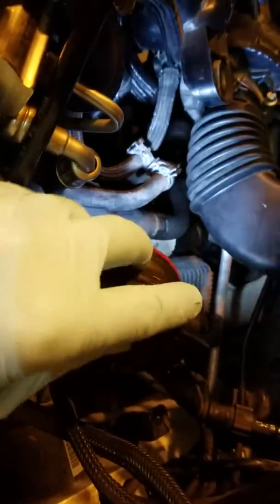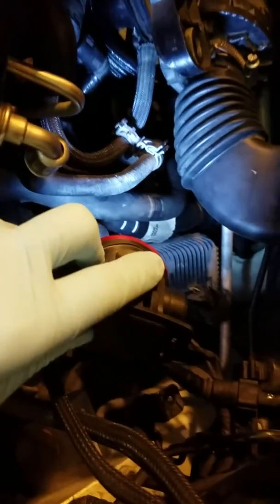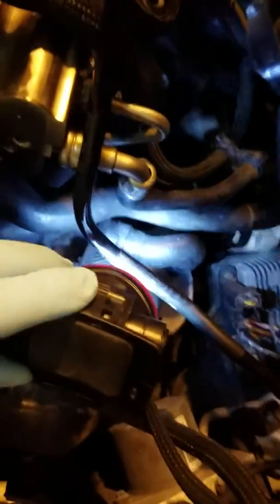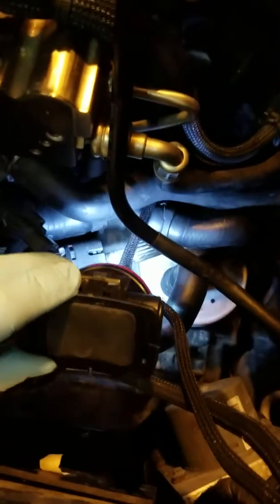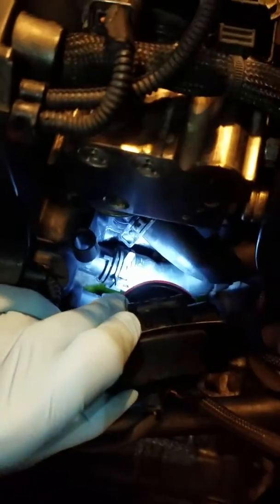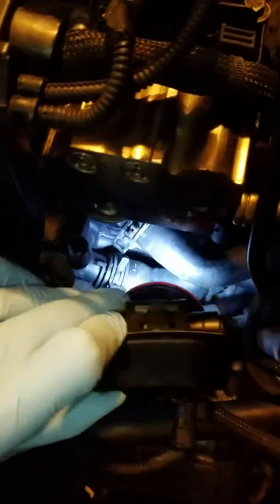What a lighting, it's crapola. On the left side there is one heater hose. I think that's the inlet. And then over on the right side right there is the outlet. So the inlet hose is connected to this port, okay? The outlet from the heater core comes up and actually Ys right up underneath here and splits off, and one part goes here to the transmission cooler, and then they both connect to go into the thermostat body on the lower section over here. And then there's a big tube up underneath that plastic that comes around and runs all